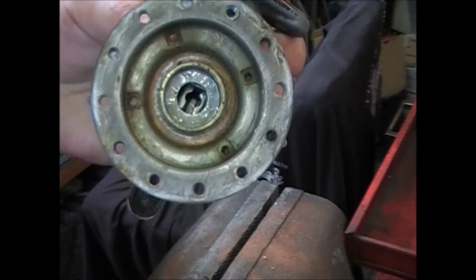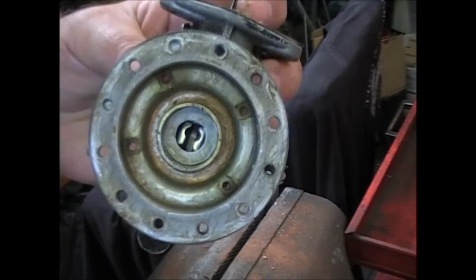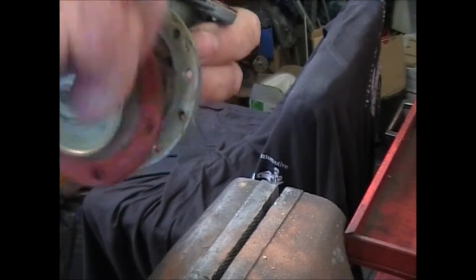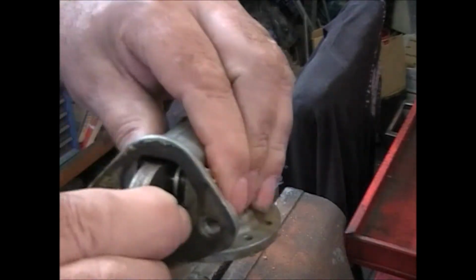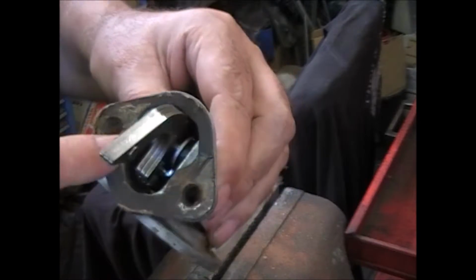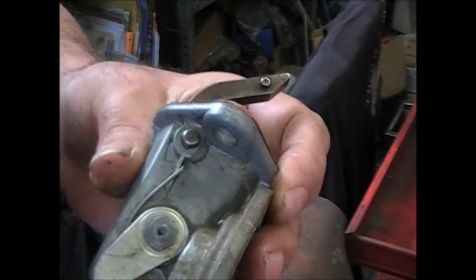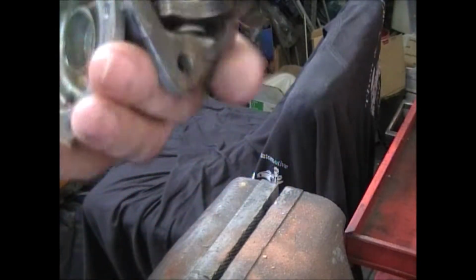As you can see down inside, see how that pull rod is. I mean the link down inside that allows that pull rod to key into it. And you push it down to go through it, turn it, and it hooks on. If you suspect there's a problem with the arm, if there's too much play this way, or the whole arm moves up and down, and you can tell that there's wear in that pin, to remove that pin, there's a little clip right in here. Knock that clip out, slide the pin out, and the arm will come out with the link. And you can address that problem, and you get a new pin with the kit.